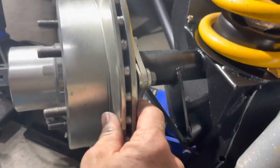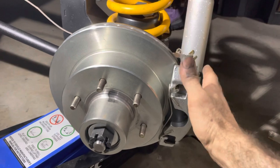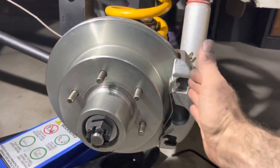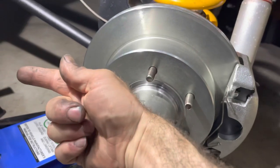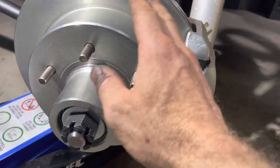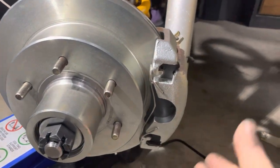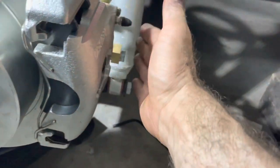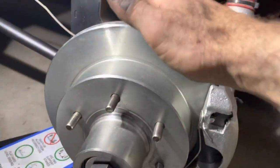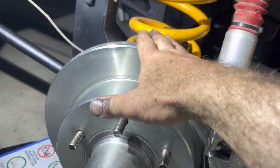You can see how the caliper is going to sit inside the wheel, so go ahead and bolt it up to make sure everything sits correctly. The caliper bolted up with the rotor on - this caliper sits on the rear side of the rotor, this direction being forward and that being rearward; this is on the left-hand side of the van. The caliper is a vertically mounted rearward caliper - this is both a good and bad thing. The good side is it stops the caliper from getting blasted with rocks and damaging the bleed nipples.